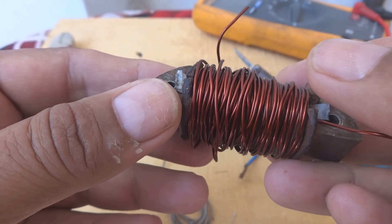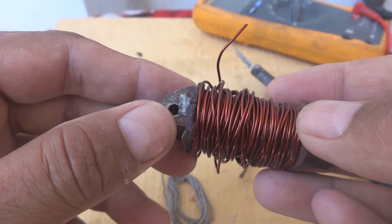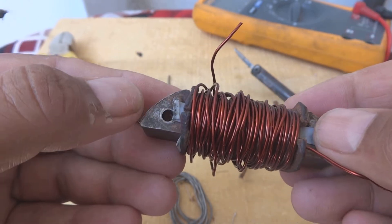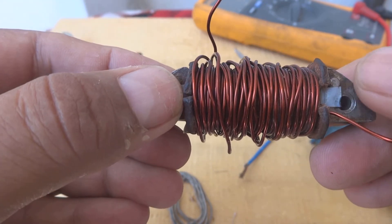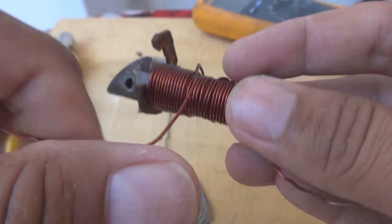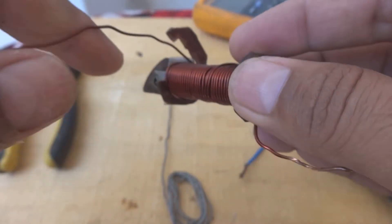We are going to eliminate this system — we are going to modify it to CDI. The bike should be CDI; the contact points system is no more. We are going to replace this thing, because before I already replaced this coil, but somebody later changed it back to the contact points system. The contact points system is not good. You can see this mylar paper — I put it in before. So we are going to remove this coil from the former. This coil was wound by somebody before me; they modified my design back to the contact points system, which is even worse. I was not expecting this.